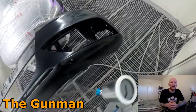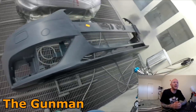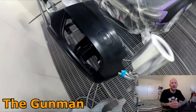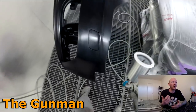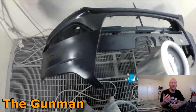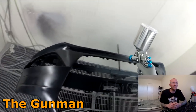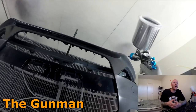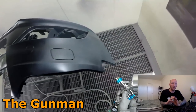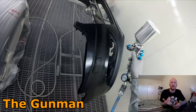I was in here painting an Audi A4, laying down some base coat. I found it needed a little bit more pressure than my standard guns - my DeVilbiss GT Pro, Pro Lite, even my Sagola. I ended up cranking it up to 3 bar; anything below that and it just didn't seem to atomize very well. But it's definitely capable of getting the paint on nicely - the fan isn't too small.